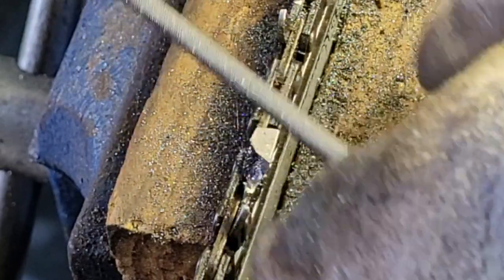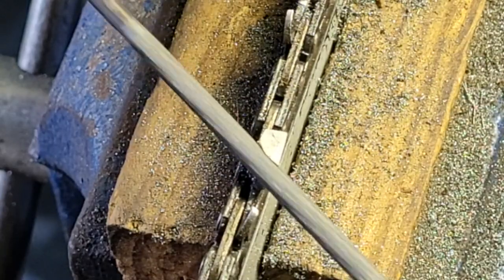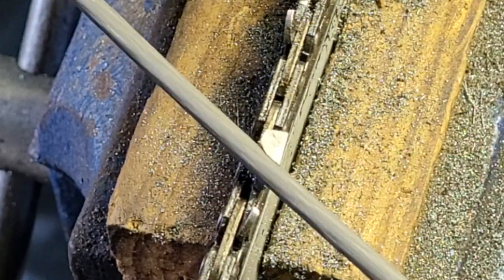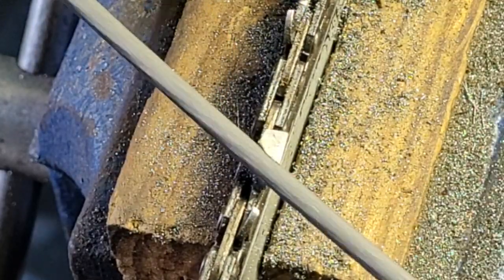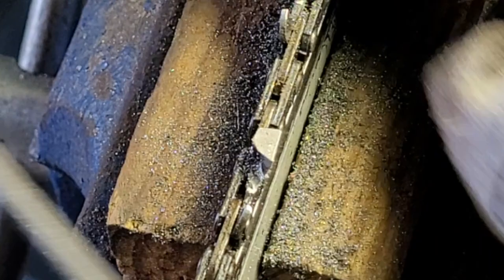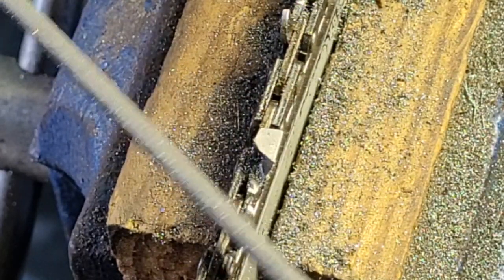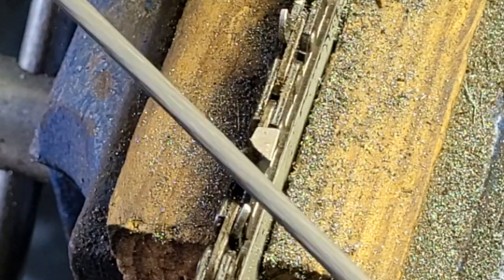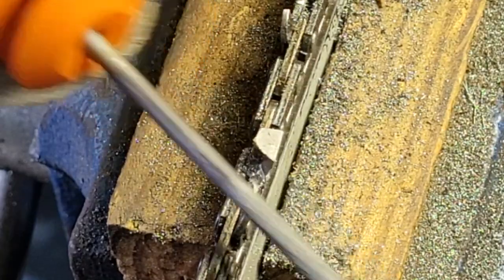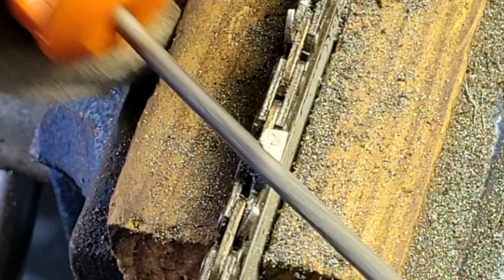One of the things that a lot of times people like Buckin, who's really good at this kind of stuff, sharpening a chain, done it for years and years, he doesn't even think to tell you a lot of times. Sometimes he does. If you're not shedding shavings with every stroke, then your file needs to be changed. It took me a long time to learn that.